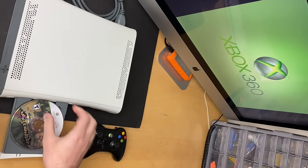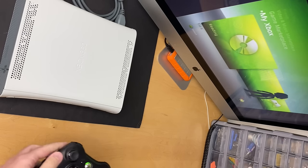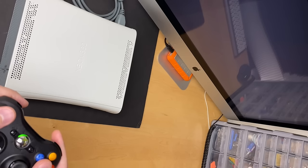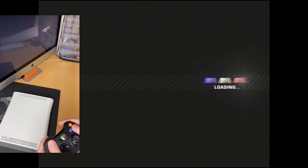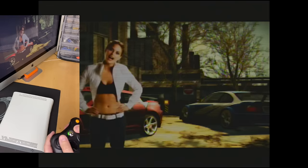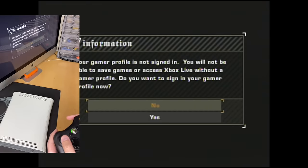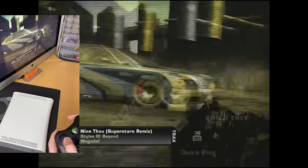To play devil's advocate — you could always argue the proper repair is to have the GPU reballed professionally using a BGA workstation by someone that knows exactly what they're doing. But context is important: I have $5 into this unit. This is a 12-plus year old console and I'd sooner salvage it for parts than pay anyone to work on it. I also haven't seen a single high quality tutorial that thoroughly covers repairing this issue without specialized equipment — the ones I found don't even use flux. I also think it was a good idea to remove those plastic anchors around the GPU and the CPU. If you have copper surfaces with good solder and flux, you don't need alignment aids — they're just going to pull towards each other. I do think those two things are going to prolong the life of this repair.